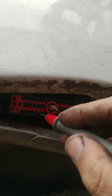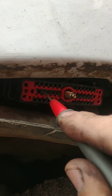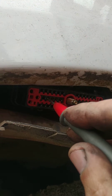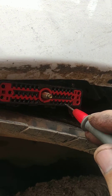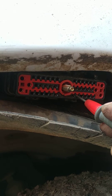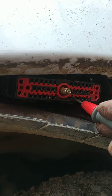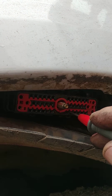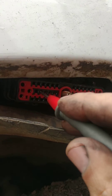On the right bank, number 24 is the ground circuit. So from 21 in the middle row, count 22, 23, 24 — it's going to be the fourth one to the left in the middle row. You keep it in number 24, that's your ground, and then you're going to test the positive leads to each injector. The second hole to the right of the screw on the bottom row is number six. So you're going to go 24 and six — that's cylinder number one. Next you're going to do 24 and 21. You keep 24 in there because that's the ground; 21 is the first one to the left of the screw in the middle row.